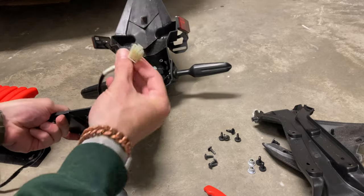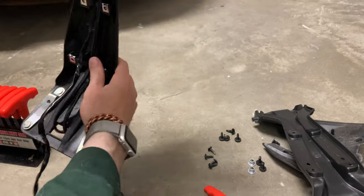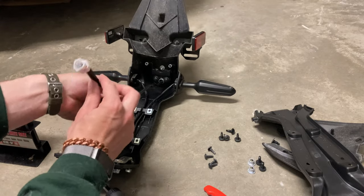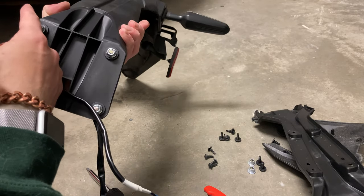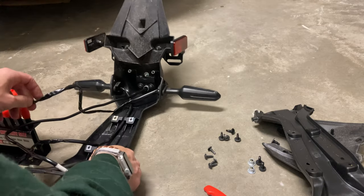The central connector that's kind of yellowish in color here must be for the license plate light. Make sure to plug this white connector here into the corresponding white connector under the seat, and then fold over the cables and snug them down. Just keep popping these cables out here.